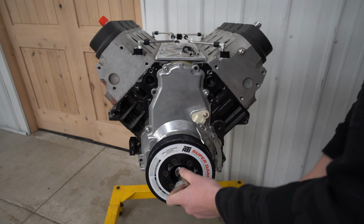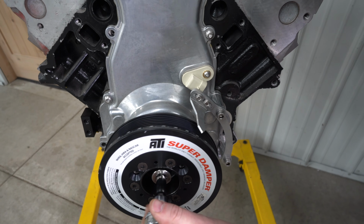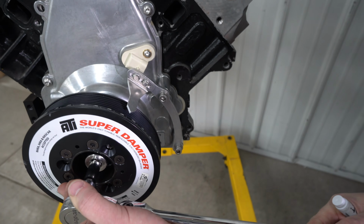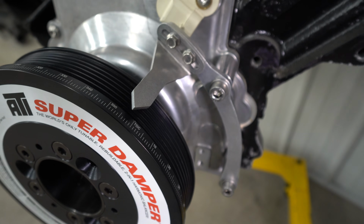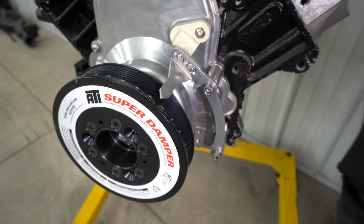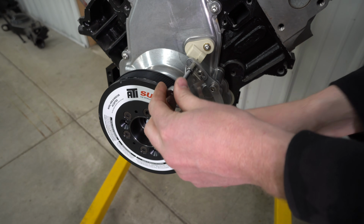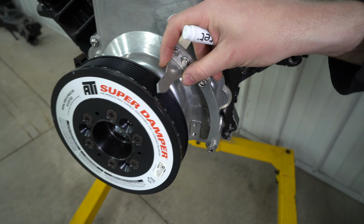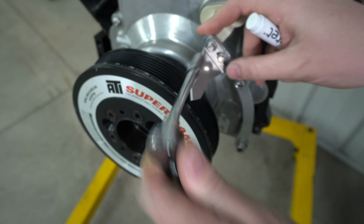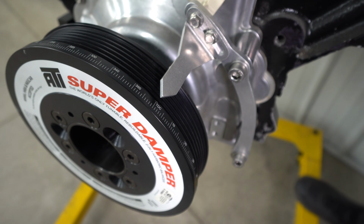Once we have our stop out, then we can roll this engine up to 357, which would be our -3. Now we just simply loosen the 2 timing pointer bolts. We readjust the pointer to 0. Now our pointer is when the piston is actually at top dead center.